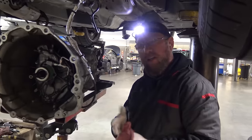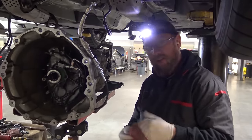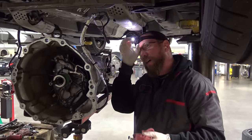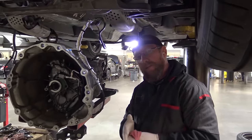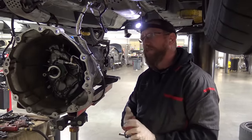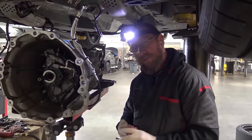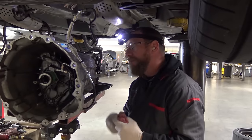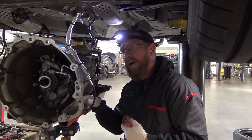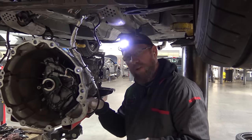Modifications as in, like, rotors? Okay. With upgraded vented rotors, cross drilled, slotted, what have you. The Brembos are smaller, but yeah, because my 350Z had 13-inch rotors. But they cool better. Right. So it's just from my experience and feedback with customers who track their car, the small upgrade of brake rotors will take away a lot of the brake vibrations due to warped rotors, and so on and so forth.